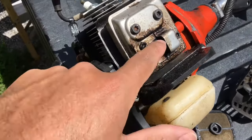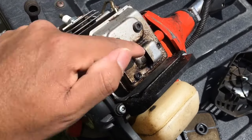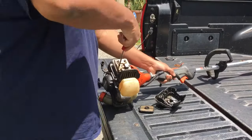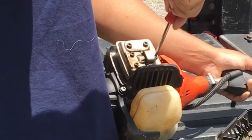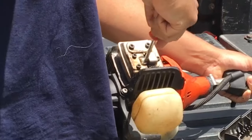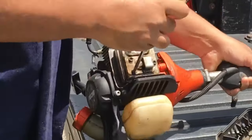This piece right here is where the muffler spits out its exhaust through this little slot right here. This is where the spark arrestor is sitting — it's sitting right under this plate right here. There are only three bolts holding this plate together. I think it takes a T25 screwdriver to remove these three screws to get to the spark arrestor.